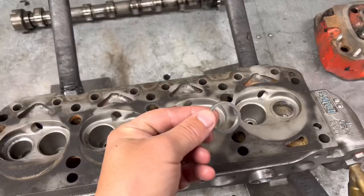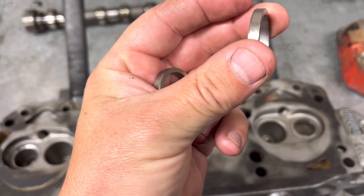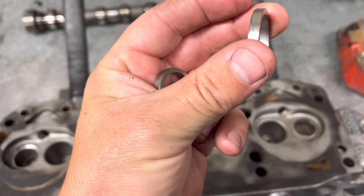As you can see, the inserts have turned up and they're slightly too small on the inside. All I do is just stick them in the lathe and turn them out to what I want. These are 26mm — you can see I've put two in already. It may look about right really. I'll get this set up, get these other two in, and just finish it off. I hope you enjoyed that, guys — if you haven't already, hit the subscribe button, like, comment down below, and we'll see you in another video. Have a great weekend, cheers guys!